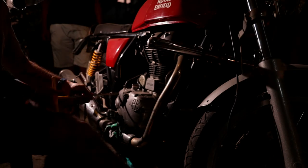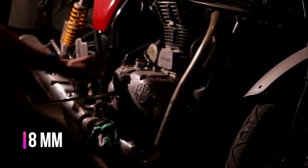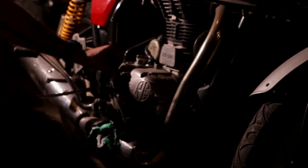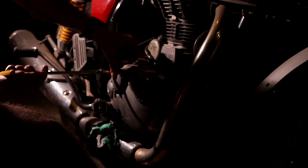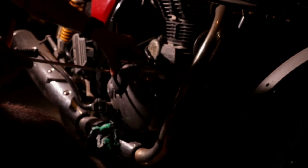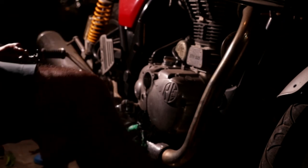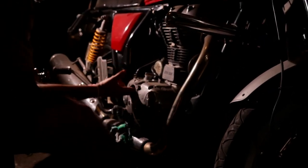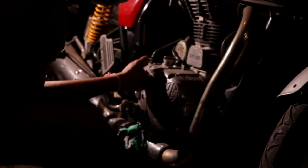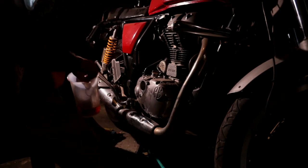Place a cloth on the exhaust pipe to catch any oil that might drip when you open the oil filter cover. Otherwise, it flows onto the exhaust and when you start the bike it's going to burn and create a nasty smell. Now, moving in a criss-cross pattern, loosen the bolts holding the filter cover in place. Carefully holding the cover, remove all three bolts. Slowly let the spring expand and pull the cover away. Remove the o-ring on the cover and then pull out the oil filter as well as the o-ring at the back of the oil filter. Using a clean cloth, wipe the inside of the oil filter housing to remove any old oil. Soak the new oil filter and the two new o-rings in oil and then fix them back in the housing.